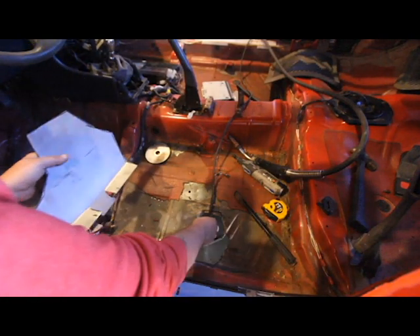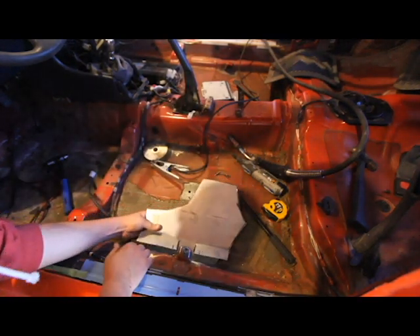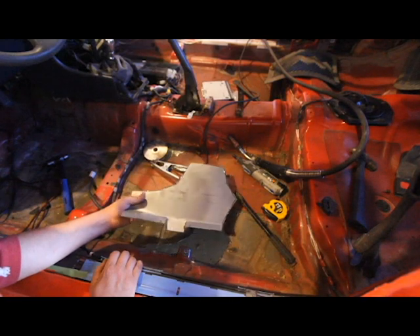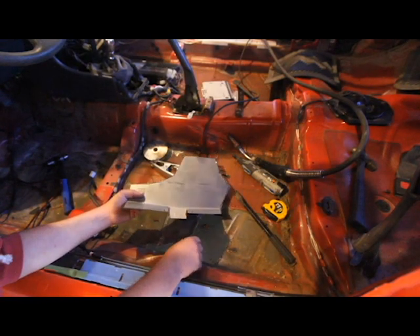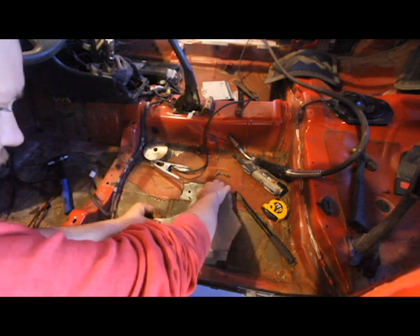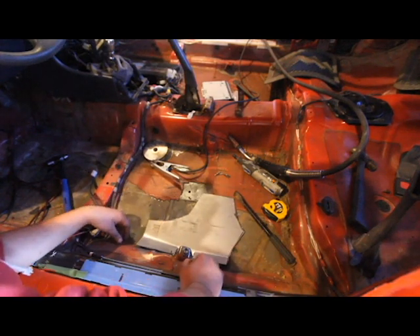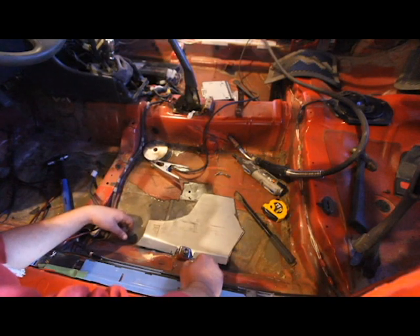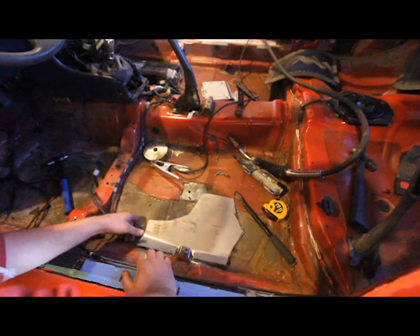So I've gone and cut the slits here to kind of go around that, and then I've bent the panel a little bit more here. What we're going to do is try and get this portion right here - that you can see hasn't been bent yet - up in behind here, just for a little bit more structural bracing. Right now I'm just in the process of getting my bends correct. By the looks of one bend here I might have over-judged a little bit, but that's easy enough to form back into a workable shape. We'll keep you guys updated and go from there.